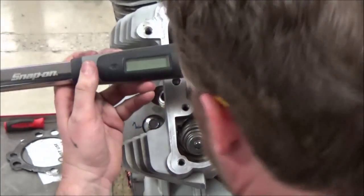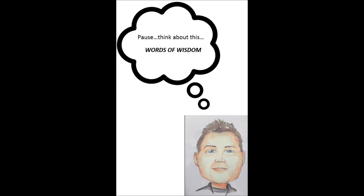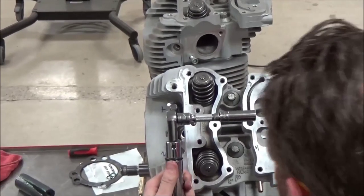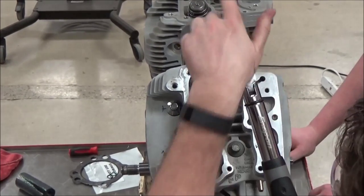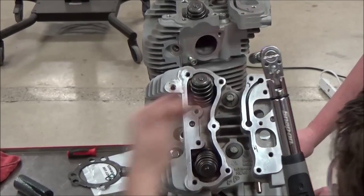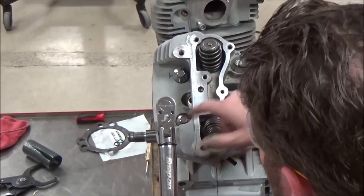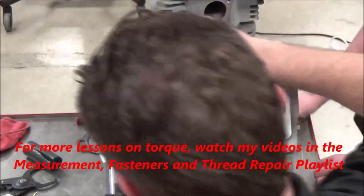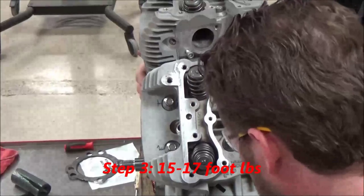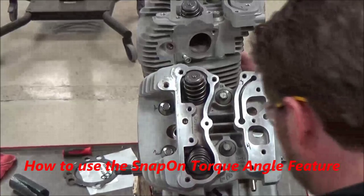Check out the summary at the end of this video — I'll explain more why this is listed as step two when the service manual states it is step one, at 120 to 142. You can use extensions inline, but you cannot use an extension that goes outward or backwards. If you can't reach a fastener and need to use a crow's foot, you need to set it at 90 degrees — watch our fastener playlist for more info on that.